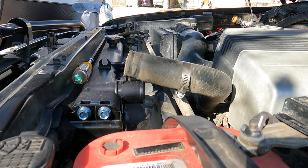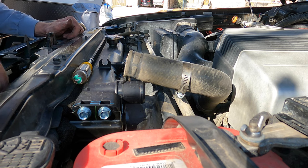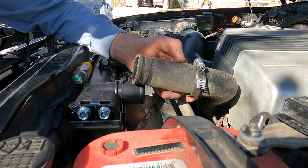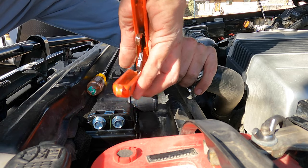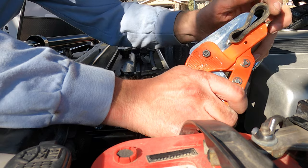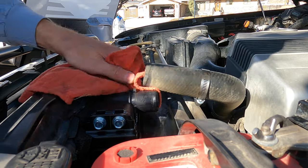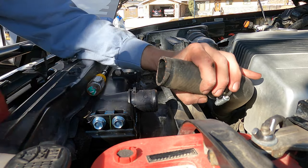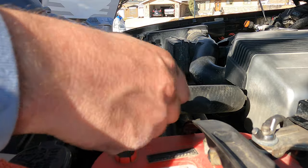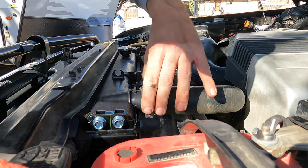On the T-fittings I did reuse the pinch clamps because they're super tight down there, but on this one they weren't so tight — same thing with the lower — so I did replace them with some regular-style twist clamps. Maybe next on the list I'll put some new upper and lower radiator hoses, but these should get by for a while.